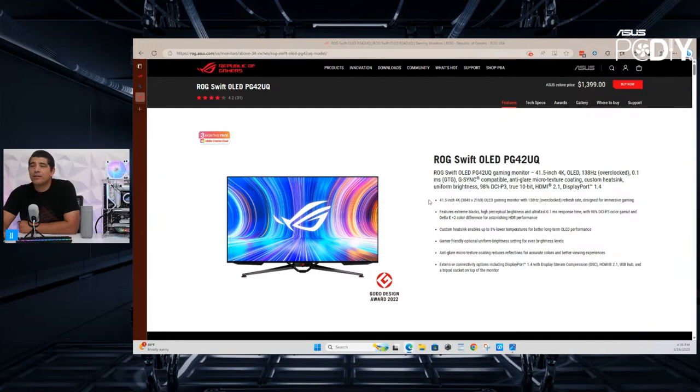Also, if you're comparing it to a TV, TVs aren't very good at working as a monitor. They don't support correct resume, sleep and hibernation functionality where a monitor does. If you check on users, a lot of users can be very annoyed by this. So for a more apples to apples comparison, I would evaluate our 42 or 48 inch OLED solutions to something like a large format TV. Although again, there are going to be significant differences between the way a TV is designed versus the way a monitor is designed.